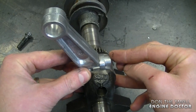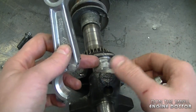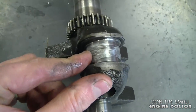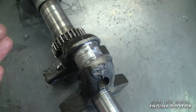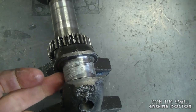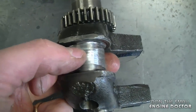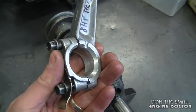Sometimes this causes the rod to be tight on the crankshaft when you put the bolts back on. Even if the rod turns on the crankshaft, you should still clean off the aluminum burrs left on there. What works really well is some emery paper — start off with a 200 and work your way up to a 600. Make sure to get the cloth-backed type, as it's much easier to work with. Be patient; the aluminum should come off before you end up sanding off any steel.